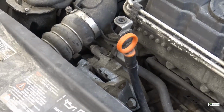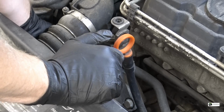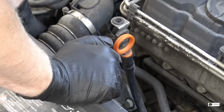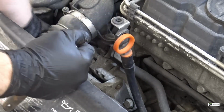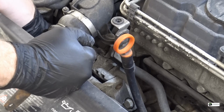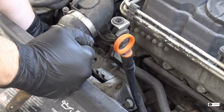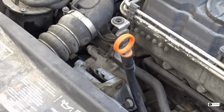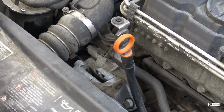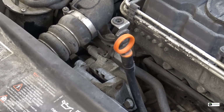Yep. To loose the alternator you have two also 13 millimeter nuts holding it. No, it's not nuts, it's bolts. Lots of bolts. Hopefully releasing these two is enough to get the whole alternator on the bench, so we can more easily assess the damage. Of course, if you don't have enough work, you create some yourself.